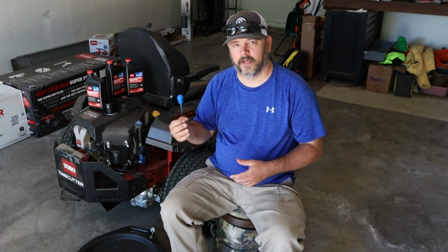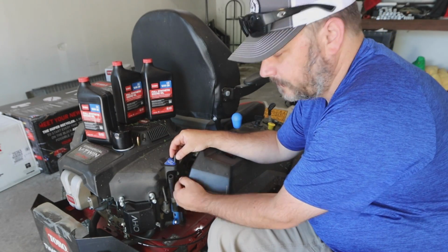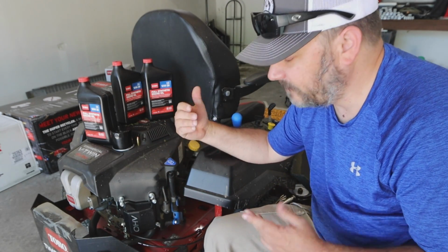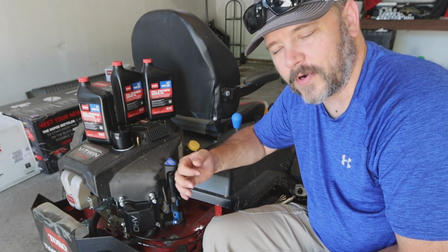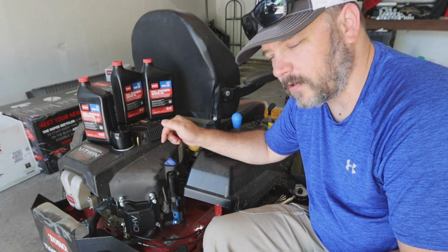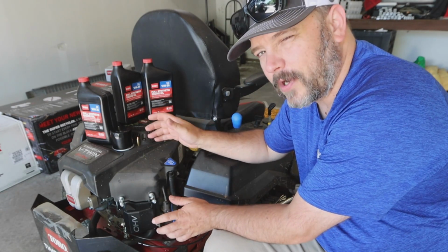So I want to bring you in here and please take my advice on this. Come in closer. So when you're taking your drain tube off, please be careful. This is the plastic nipple that sticks up inside of here that actually entraps this tube to keep it up into this hole. When these things are brand new, if you've worked on any engines, dry rubber tends to stick to everything, or dry tubes, like under your engine compartment, they tend to stick to everything if they're dry. So when these come out from the factory, these are installed dry, there's no lubrication on them. So these rubber hoses are really hard to get off. So take your time when you're getting this drain tube off from under here the first time. After your first time, it will be lubricated with oil and you're not going to have that problem.